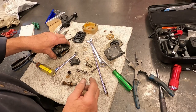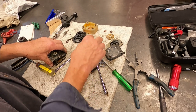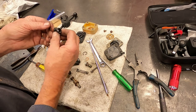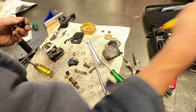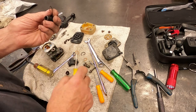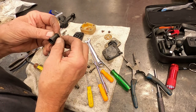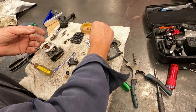I've got it disassembled now. To disassemble this and get the little plunger out, you first have to pull this little keeper that holds the rubber sleeve in — it's a little snap ring, not easy. You have to get in there and pry it and pop it out. This one's all crusty. Behind that little unit is a fiber or nylon washer, so that comes out.